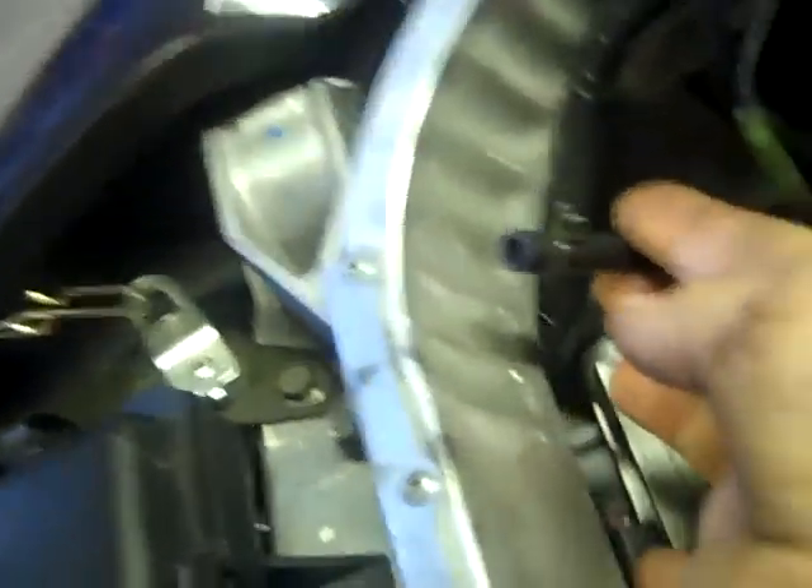The first thing I do is open the hood. I've already loosened the clamps, but under this flap right here there's a set of clamps. You gotta loosen these screws right here, and then you gotta pull this strap right here, and you can get the air box off. It's got two hoses that connect to the air box - one's right here and another one right here. They connect here and here. I'm going to set this to the side.